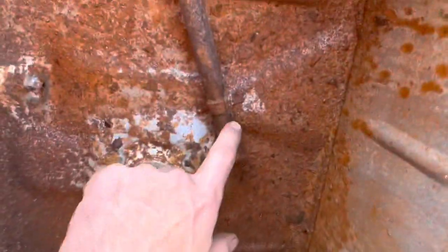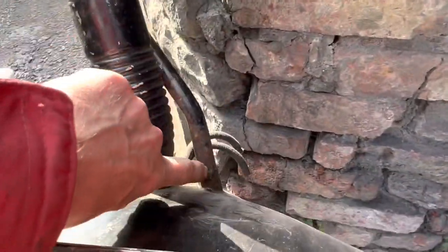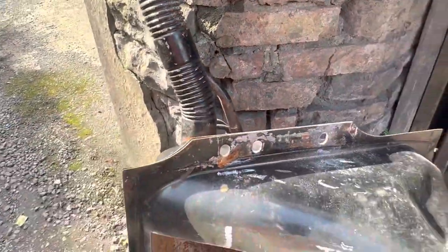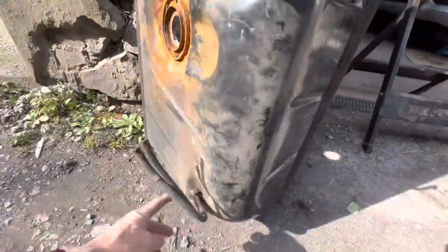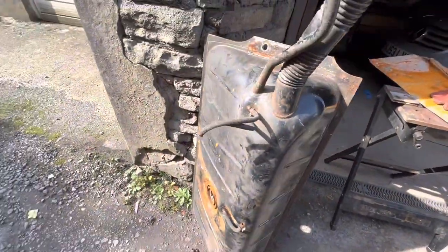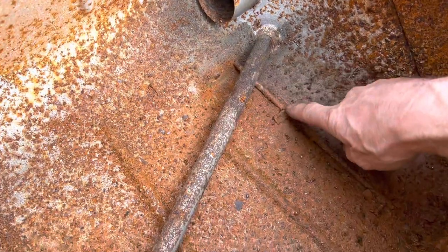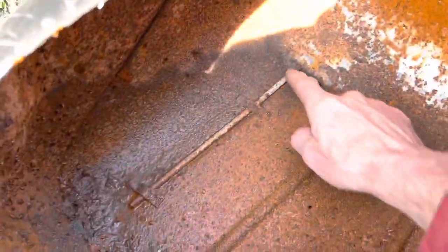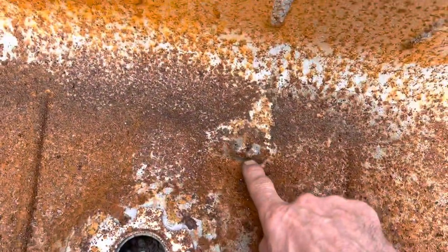Now this here is the breather line that runs out here — that's the part that's damaged on our other tank, so we could potentially use that. On top of the tank you've got these hoses here — one, two, three, four, five — and these all go to the plastic header tank which sits on top of the fuel tank. You can see one is a short pipe and the other is a longer metal pipe, and the same on the other side. These are to vent the tank, and there's another one here.